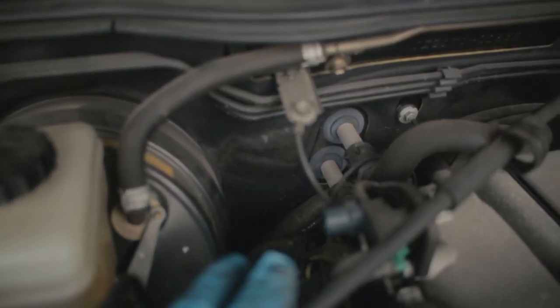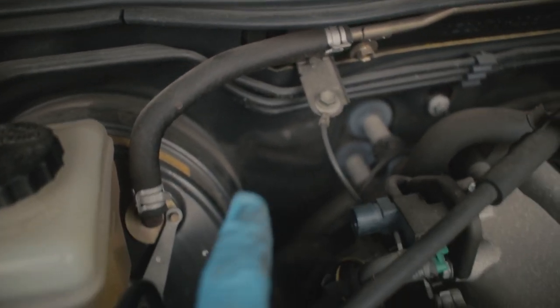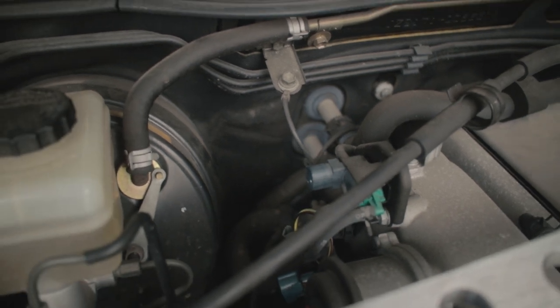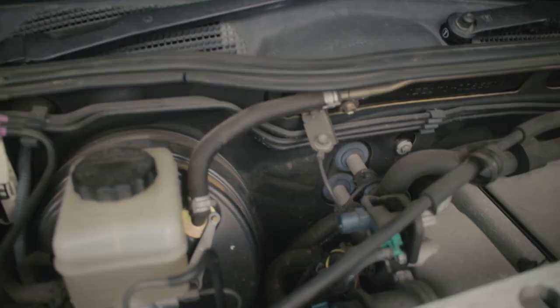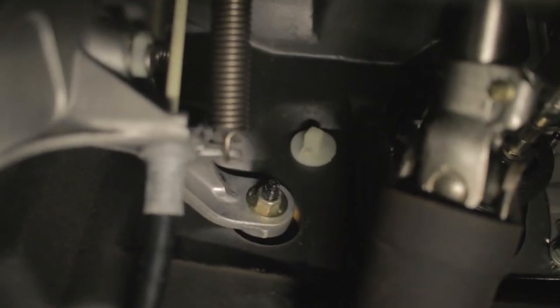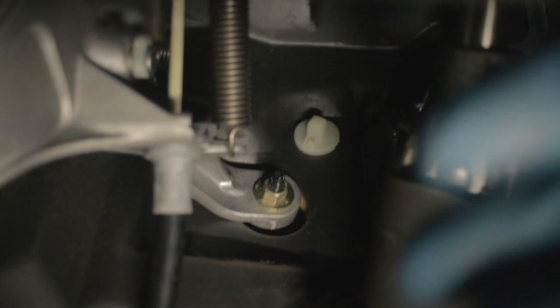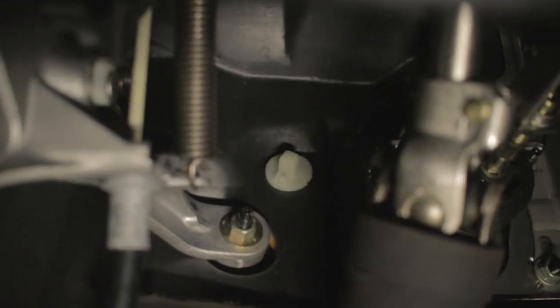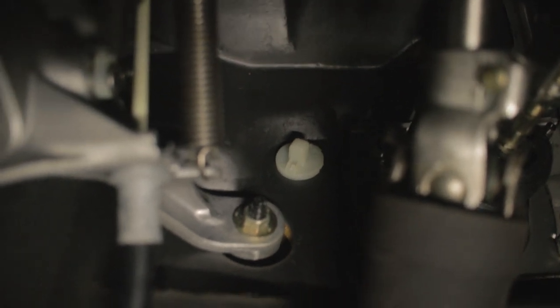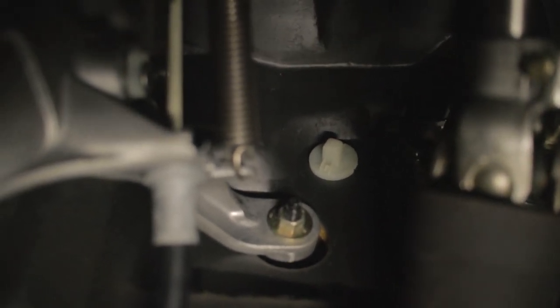In the engine bay, where the master cylinder normally goes — say on the Lexus IS300s, which I've converted quite a few of — there is a hole in the sound deadening and you can see where it goes. But in this case, on the Toyota Crown, there isn't anything there. So I'm thinking we're going to tackle it from the inside of the car. You can see this is the aluminium bracket for the foot e-brake, and where this white grommet goes, that's where the clutch pedal and clutch master normally is. We've got some sound deadening, so we can't see where the actual location is.